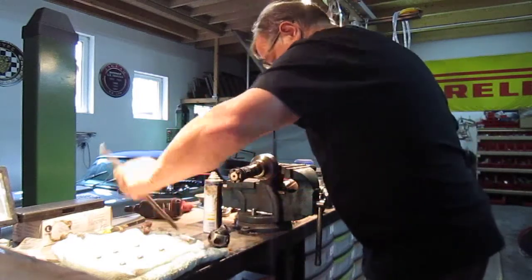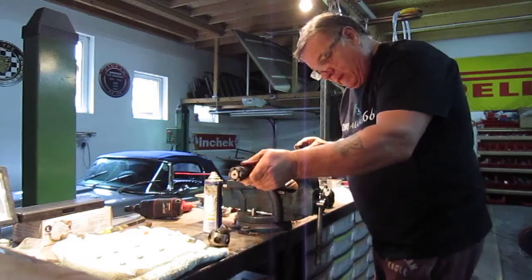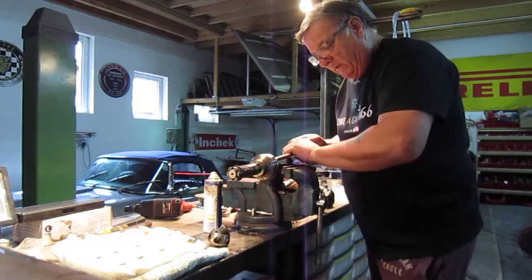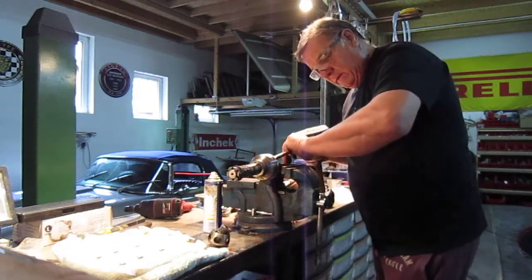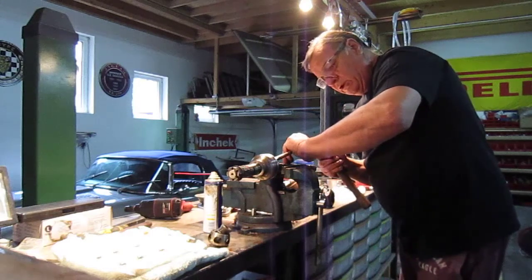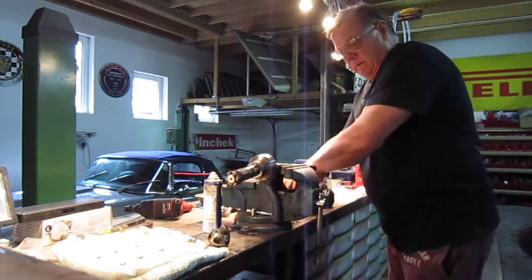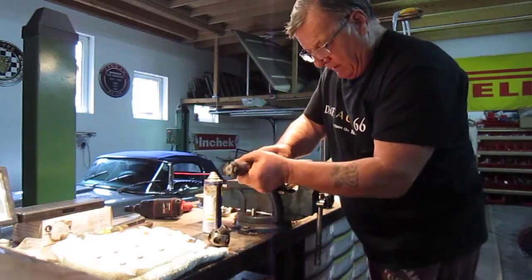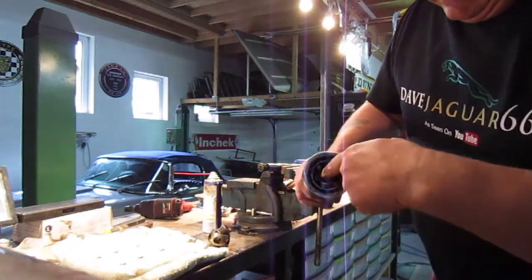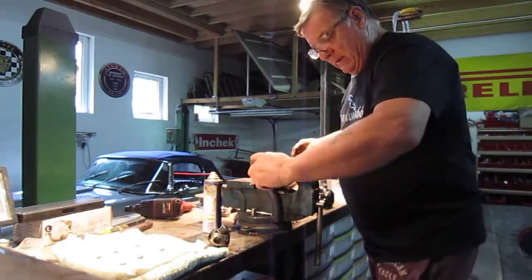Okay, I'll take this end off. What's the best thing with the outer, if you can, is try and get somebody to hold it and pull on it, because then it will go over the C-clip a bit easier. So something quite blunt, get it nice and straight, a short, sharp blow, and it will compress. There you go, and there it's off. And you can see inside, this side obviously is a lot better.